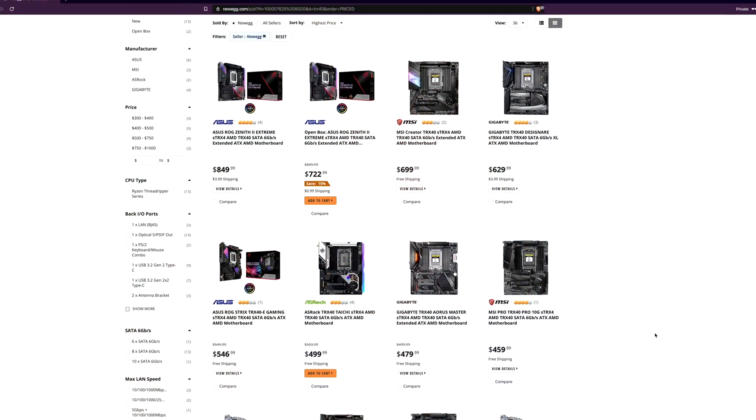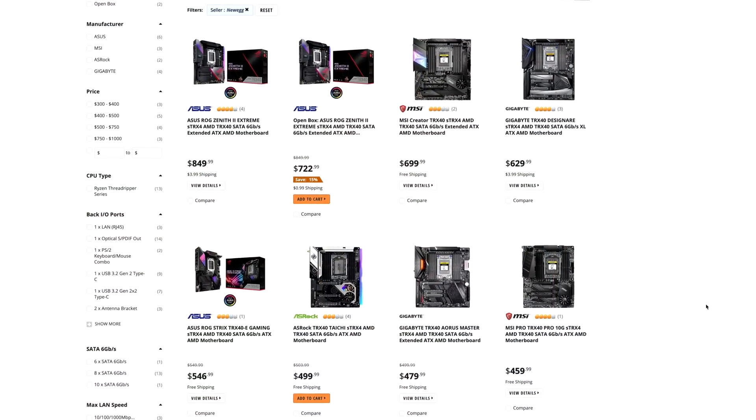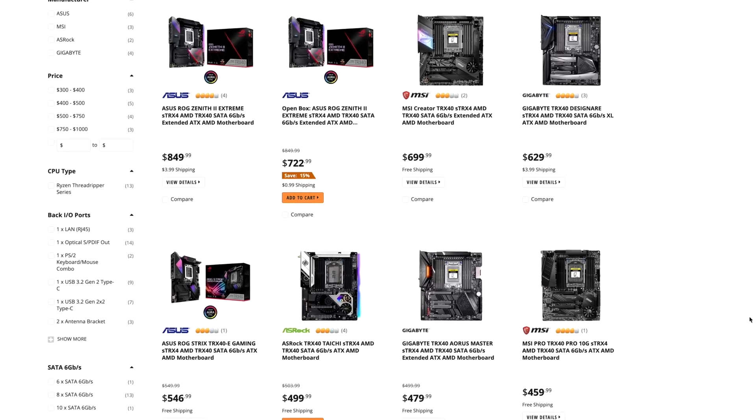The most important part of any build is the motherboard, and my demands on it were really high. I wanted to add this build to my video editing workflow, so 10 Gigabit Ethernet is a must. I also want to be able in the future to run 4 GPUs at once, so finding a motherboard which would suit my needs without ruining me financially was not an easy task. If you look at prices of TRX40 socket platform motherboards, the prices are really very high. So building a super powerful Hackintosh faster than the 2019 Apple Mac Pro is not a cheap journey.